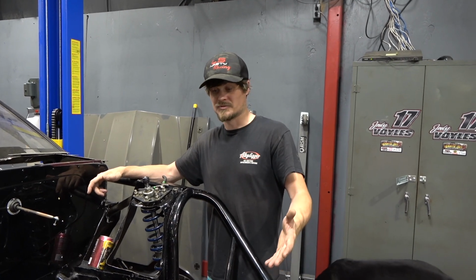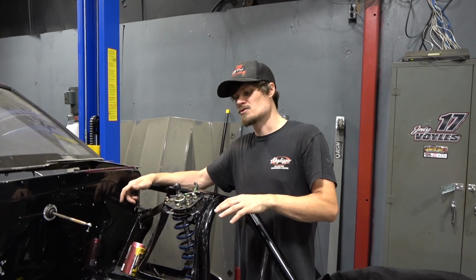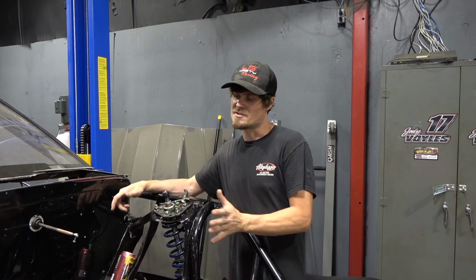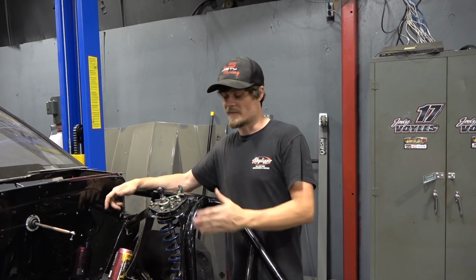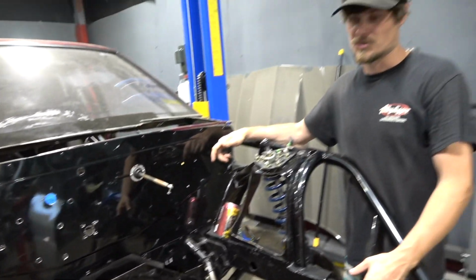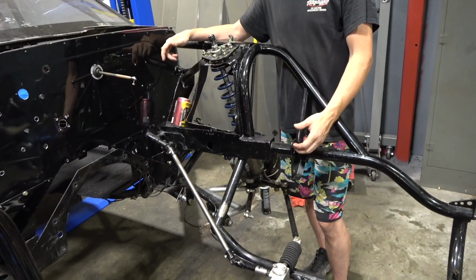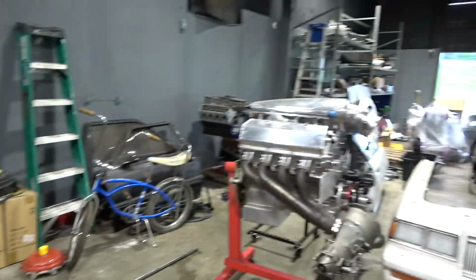You've got your fuel tank and some nitrous stuff, but with a turbo you get a lot of weight out there, and you start changing your weight bias a little bit more. So I think maybe slide the motor back. That will fix those, and then figure out how we're going to do our front here. Fortunately, if we move it much farther back, we're going to have to cut these off. Yep. So we'll get the motor set in there.